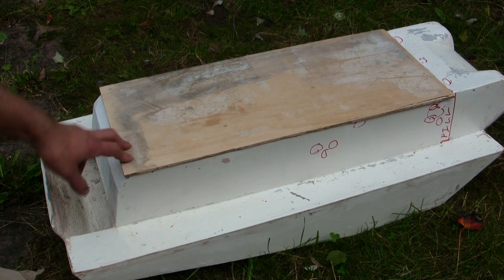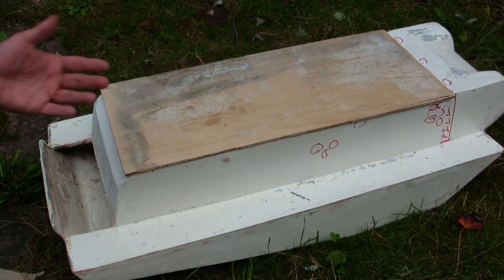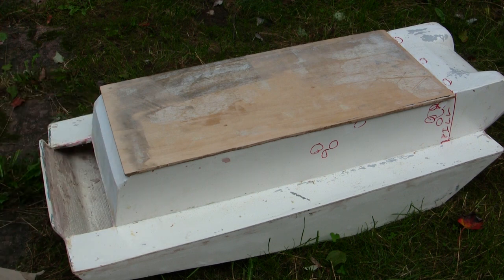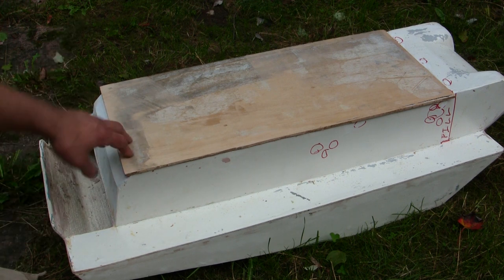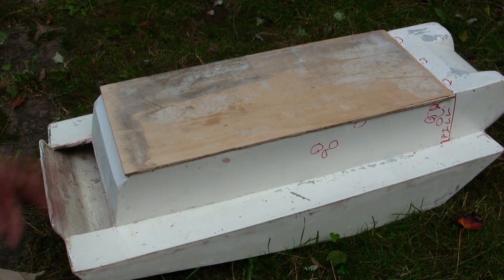From here, I'm going to go ahead and fasten the panel to the vehicle. And this is going to be done with both adhesives as well as also with just proper fasteners. I'm going to go ahead and drill some holes into this plate over here, add countersinks, and then I'll just bolt everything in place with the various bits of hardware I picked up from the hardware store.